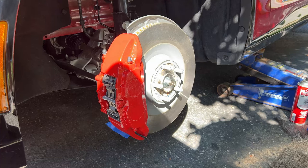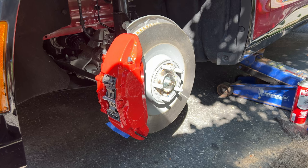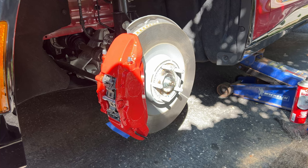The second coat is on and everything has really brightened up. There are a couple of spots up in here where the paint was hard to get to stick — maybe the first coat needed more time to dry — but we can hit those up after; it's not a big deal. Overall quite impressed with how it turned out. If you do get paint somewhere you don't want it, rubbing alcohol, paint thinner, varsol, or even brake cleaner will take it off. That paint is thick — two coats and we've hardly used anything from the container.